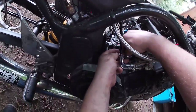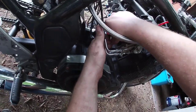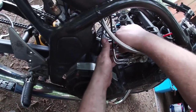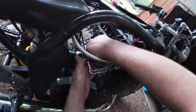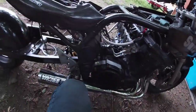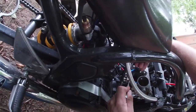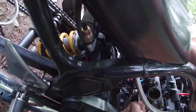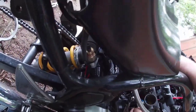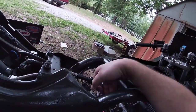Okay, I'm going to put this 14 pill in the nitrous side. And slide the AN6 to polyline adapter over it. And we will go ahead and snug that fairly tight. Not super tight because these strip really easily, and on the nitrous side, leaks are freaking minimal, and even if it does, I'm not worried about it. There we go. So we've now got all our pills changed.